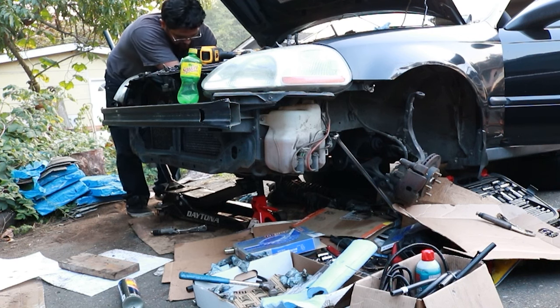We do have smoke out here — it's coming from the Oregon wildfires, another perk of doing this when I'm doing it. The transmission speed sensor here is off a manual; they do have one on an automatic and the plugs look the same, but I'm not 100% sure the contraption is identical, so I'm not going to test it. All I have left is to slap in the starter and wire it up and ground it.